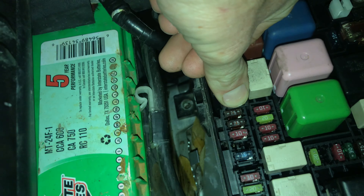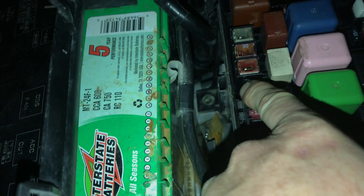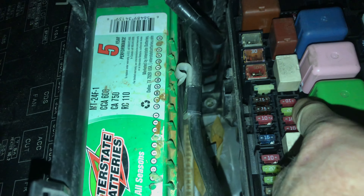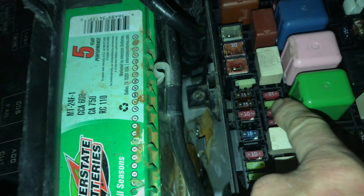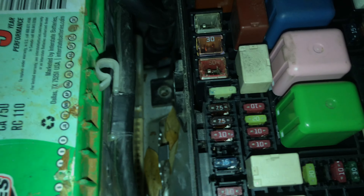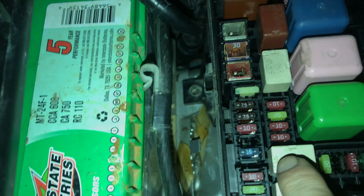A short pin is not a fuse. Let's look inside — it's literally a thick piece with the same spade terminals, same thickness, so it won't blow out. It belongs in here. What it does is it takes B+ from over here, puts it through here and into this side of the fuses, and then the other side goes out to where it needs to go. I may be confused on which sides, but it doesn't really matter — it's one or the other.